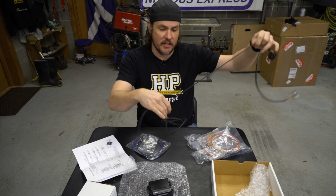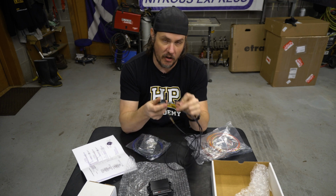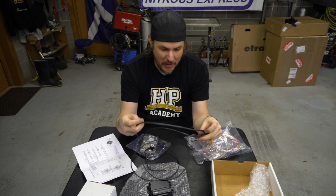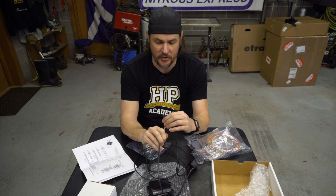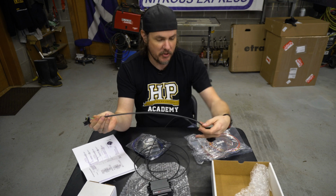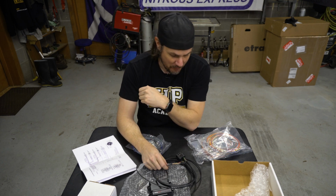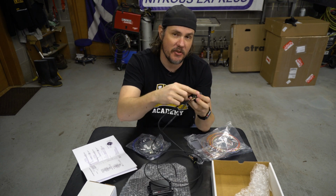And then our other wire is our ground wire, and it splits off into 4 different terminals on the back of the connector that need to be grounded. And this one's plenty long, that's nice. If anything, maybe don't put an end on these and give us the terminals. I know these terminals are so small, to the point where they're almost impossible to crimp, but it would almost be nice if they were both this length, and then we could cut this one down to length and put our ends on there. Maybe if you didn't do it that way, you could put this end on there and not terminate the end that goes into the connector.